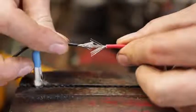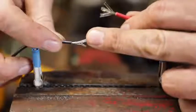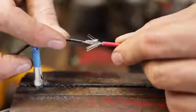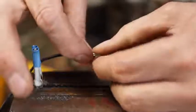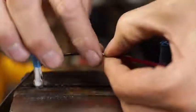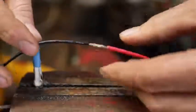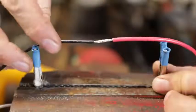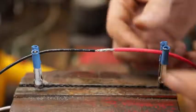For joining the wire there are a couple of different ways, but what I've found to be the best — and this is what my granddad always did — is you fray the ends of the wire like this. You join them so they intermingle, kind of mesh like fingers together. Pinch one side and start bringing everything together, then twist this side and then twist the other side over here. That gives you the cleanest, smallest profile, which is great if you're going to put shrink tubing on there. Now we can clamp it into our jaws and get everything ready for the solder.